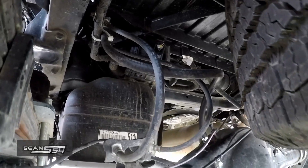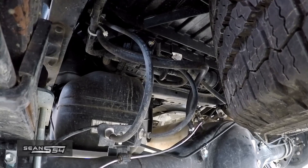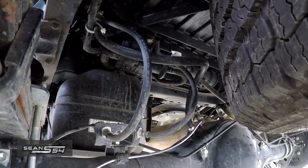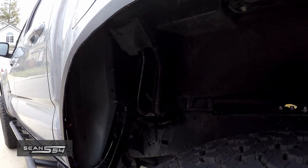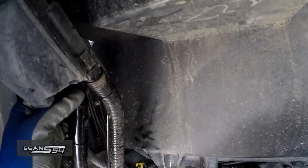Install is pretty straightforward. I recommend buying a longer hose — maybe six or seven feet — so you have more options for where you want to run it. Now it's time to go test it on some water crossings! The front already has a breather valve that runs up through the engine bay; the rear doesn't, so it's important to have a diff breather valve that runs higher than your diff if you're planning on doing water crossings. Hope you guys enjoyed the video — please like and subscribe, thanks for watching.